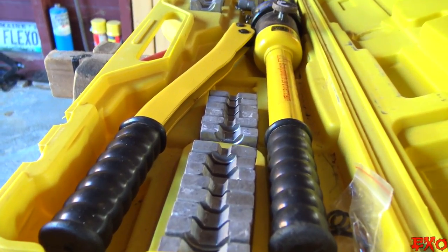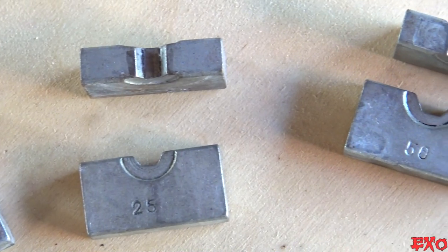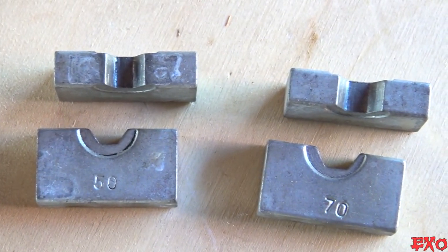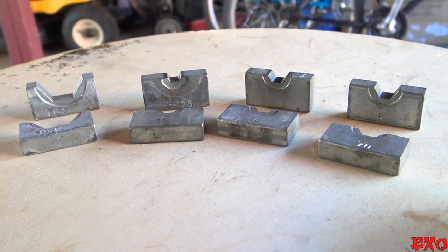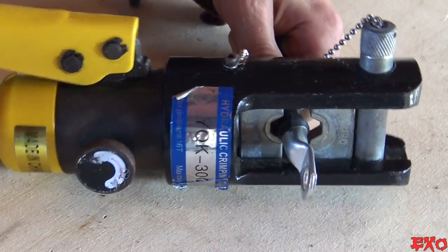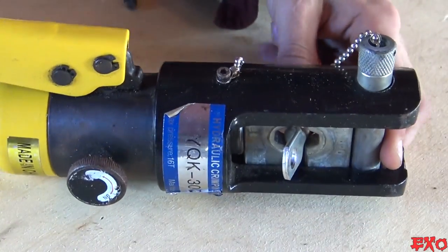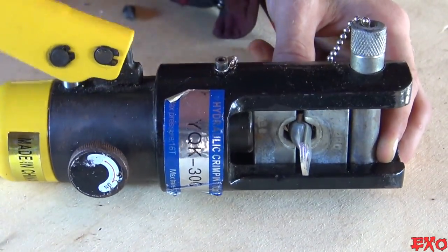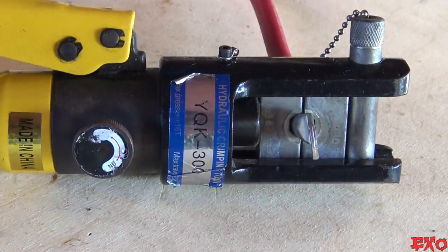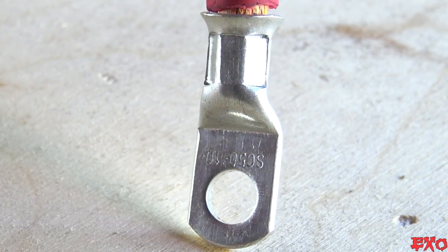To get a nice strong crimp, it's really important to use the right size dies. They come in lots of different sizes, but since we have zero gauge terminals, anything between 50 and 70 should be fine. Every terminal and company is different, so try them out yourself. Turn the valve to tighten, place the terminals inside the vise, and start cranking the levers. A solid post rises up, puts over 15 tons of pressure on the pins and dies — and you've got yourself a hulkified crimp. Just add a little heat shrink and she'll be looking real good.